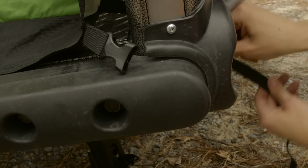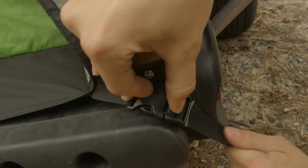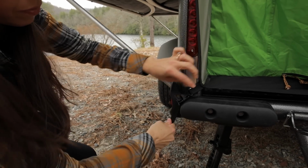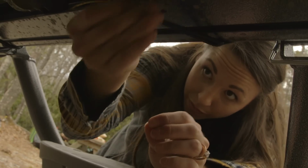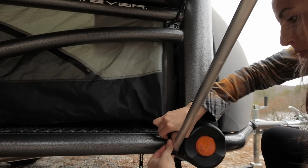Start with the 2 clip straps located at the corners closest to the step. Wrap the strap around the rear marker lamp and attach the clip. Pull the strap tight and close the clip to secure it. Once the 2 back corners have been secured, the rest of the floor can be secured with hooks that attach to a ledge that runs all along the underside of the trailer, with the 2 corners behind the storage pod wrapping around the bed support pole.